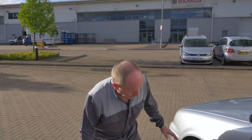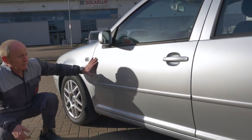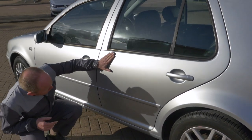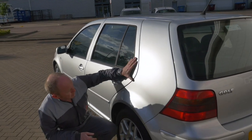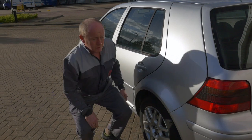Let's take a look at the final job before we give it back to the customer. As you can see, looking closely — good blend, no halo, no sign of any clouding or mottling, nothing to be unhappy about there. Very good mottling control, effect orientation on the door, perfect hiding in one and a half coats. Similarly, on the rear fender, the transition into the blender — everything is very smooth. Just what we're looking for.